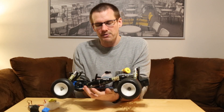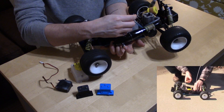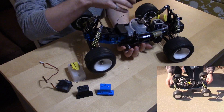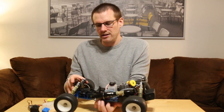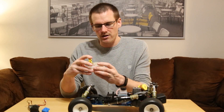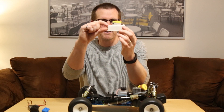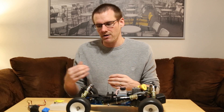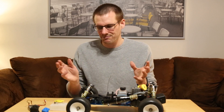What you typically do when priming the vehicle is place your finger on the stinger of the tune pipe, then pull the starter. That pumps air into the pipe, builds up pressure, and runs it through the pressure tube into the tank — that pressure then feeds the carb, and it works very effectively. In my case it wasn't working. The reason is the old tank's pressure tube from the exhaust actually goes halfway into the tank. So when I tried to prime it, pressure built up and sent the fuel right back into the pipe, creating a big puddle mess.